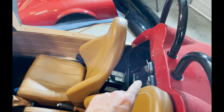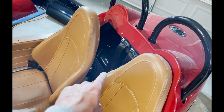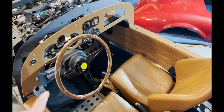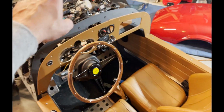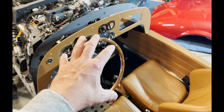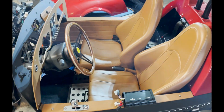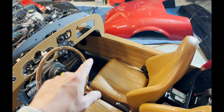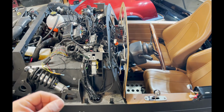I'm gonna be using speaker wires to tap into the front speakers to get that amp to turn on and make that sub work. Some other reasons are the LED wiring to the speakers. I wanna have that all laid out and ready to connect as well. And the reason I don't wanna connect any wires is because I'm fearful that because there's gonna be some double connections going to the same wire in a lot of locations, I might forget a wire and I'm gonna have to cut it and resolder it.